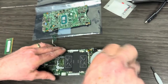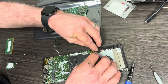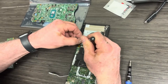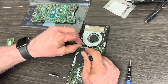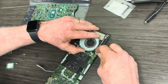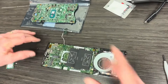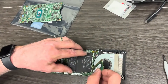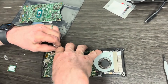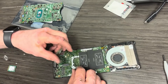I replaced my heat sink screw in the bottom right corner. Now I'm going to put my fan screw and fan connector back in, along with the speaker connector and a third wire — honestly I can't remember what that wire was for. It might be a power LED or something of that nature. The point is, take note of all your cables that you're disconnecting and make sure you get them put back in place. That one there is probably an internal speaker. Then reinsert your memory module and put the Wi-Fi card back in place, making sure the wires come up through the groove in the notch on the side of the motherboard so you're not pinching any cables.